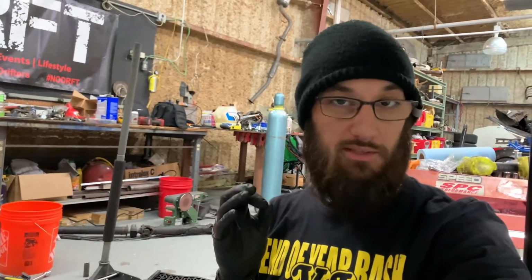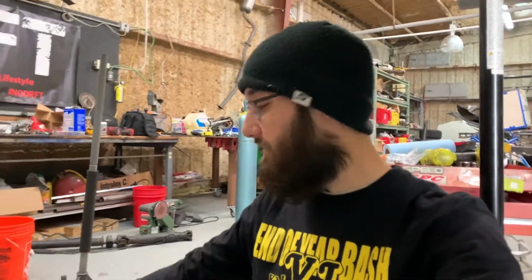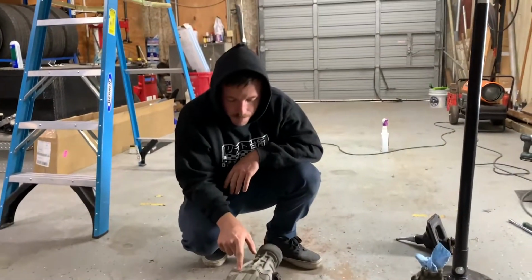We will be applying a little bit of light grease onto the nose to help the pilot bearing go in, but you want to keep that off of that disc, because, like Dom was just saying, the stock disc might hold up if I break it in properly. If I don't, we'll probably be back here later this year, guys, doing this again and upgrading to some race car parts. But for now, how's that mount looking, Dom?